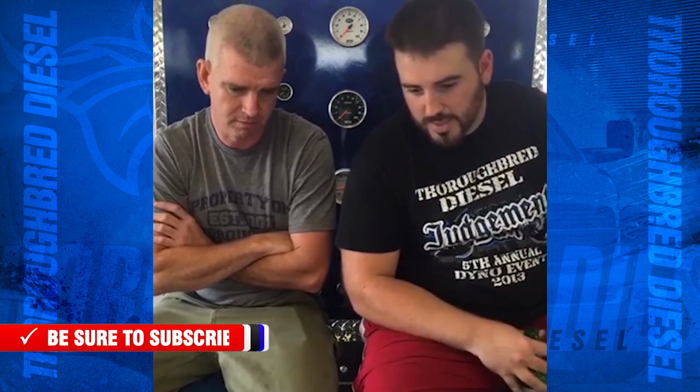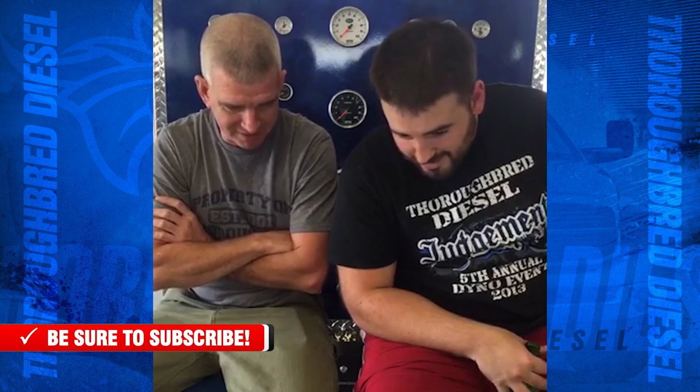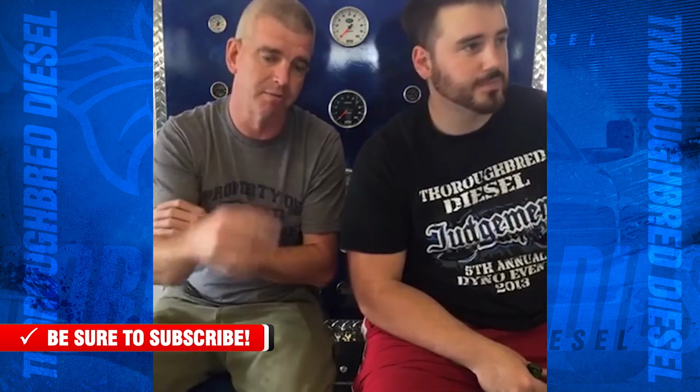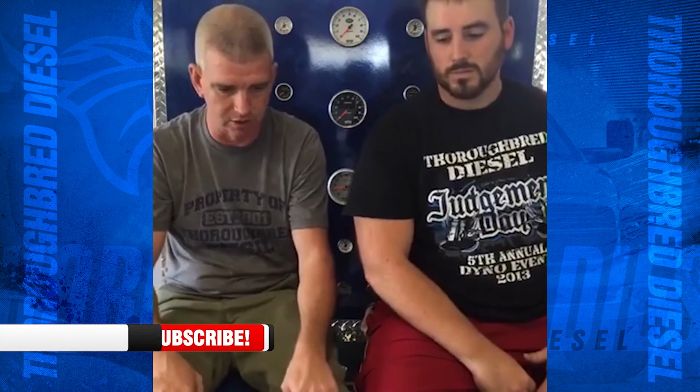Alright, hi guys. I have a 99 7.3 and it occasionally makes a sound. That's kind of hard, isn't it? It occasionally makes a sound that resembles a knock, but only does it every now and then. That could be an injector problem. You want to run all your injector tests on the 7.3, which is pretty easy. Most common scanners can run cylinder contribution tests and also buzz tests on those injectors.